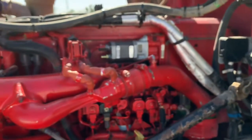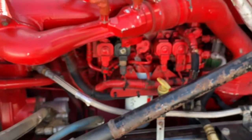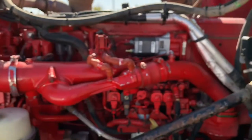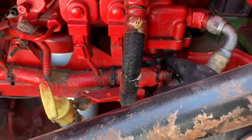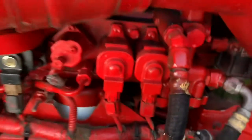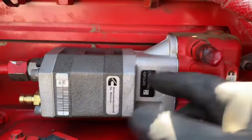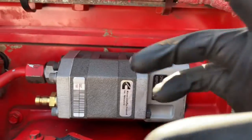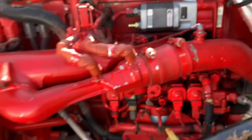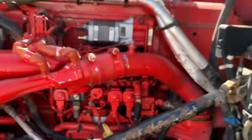Yeah, that was just a little fuel problem with this one. So this is the transfer pump right here — when you turn the key on, you hear that little noise, that's it priming the fuel system. And this is the gear pump — there are teeth on it like an injector cam, and they meet together, and that's what spins the gear pump and creates the pressure when the truck is running.